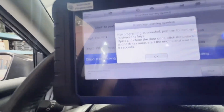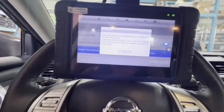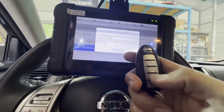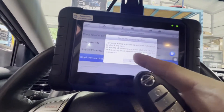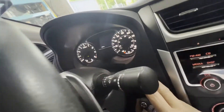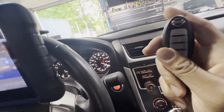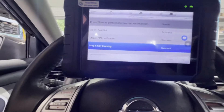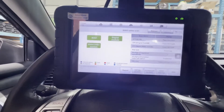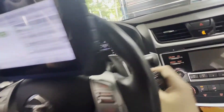Open and close the door once. Open and close, and start the engine. Click the lock/unlock button — lock, unlock. Start the engine, wait for five seconds, and start the engine. Alright, so this one started it. OK. Escape. Alright, so we got this programmed. Let's do it again.